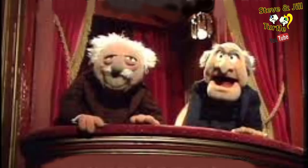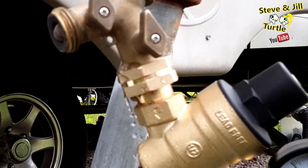When you arrive at your campsite and you hook up your water hose to that faucet, you do not know how much the water pressure will be. To protect your RV plumbing and drinking water components, always use some type of RV pressure regulator. If the water pressure from the campground is higher than what your RV plumbing system can handle, there could be issues and leaks.